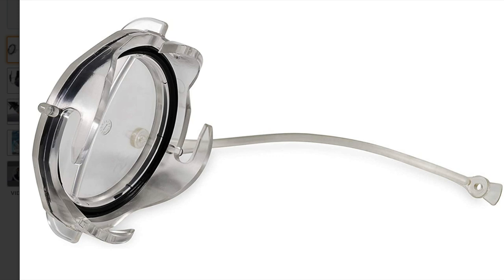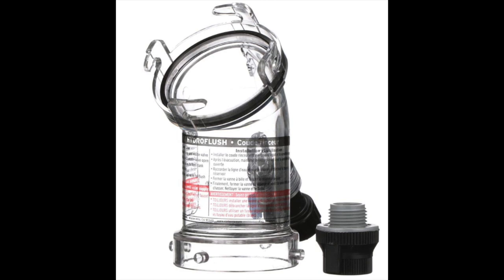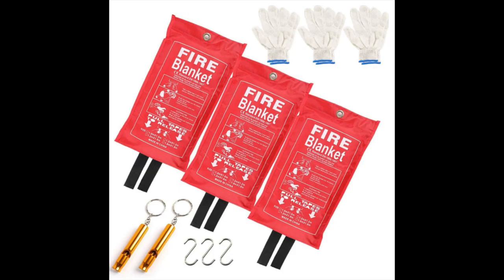It's also nice to find out what's actually in your sewer lines or gray water lines before you open them. I found a clear cap that you can put on, and that way you'll see if there's any leakage or water in there. When you're doing the draining and you hook up your hose, these clear ones are so handy to have attached as well. I hook it to the beginning part and that way I can tell when my water is clear and I'm ready to go with everything out. Check your setup because some may require an angled one — they do come in two types, either straight or angled.